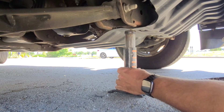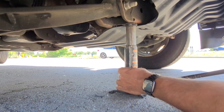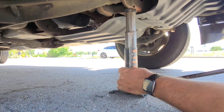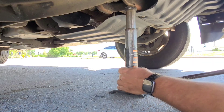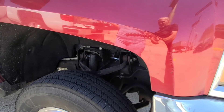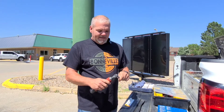You're just wanting to pick the frame of the truck up and leave the tire on the ground — you don't want the tire to come off the ground either. That should be about good; once I get in there and get the under-fender lining out I can tell. I can hear the tire about to come off the ground, so this is going to give us a lot more room to work. I've got my Milwaukee ratchet with a 3/8 to 1/4 adapter and a T15 Torx bit to take the inner fender liner out.